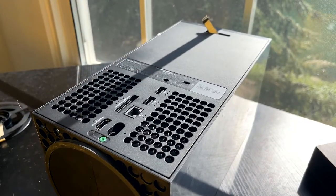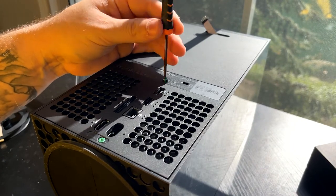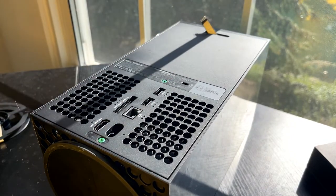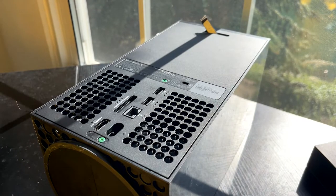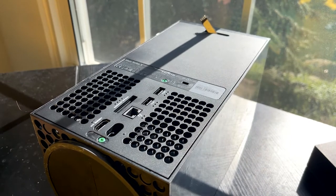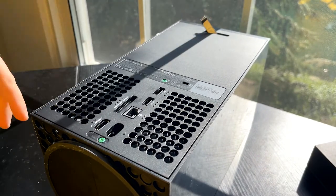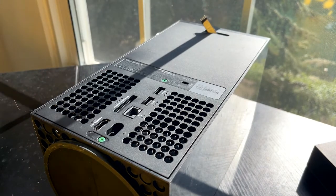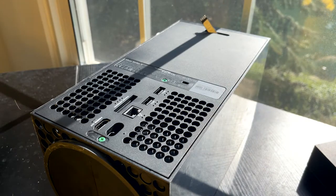While I'm screwing these in, I know I'll get some questions about warranty. I'm obviously not an attorney, but what I've been told is that if you live in the United States you actually have the right to open this device to perform any maintenance or repairs. So no, this won't void your warranty. If you do have a warranty claim, just repeat this process and get your lights out — it'll leave residue, but isopropyl alcohol rubbed around the edge will get rid of that.